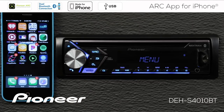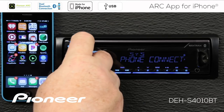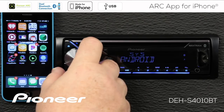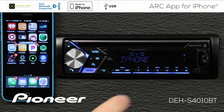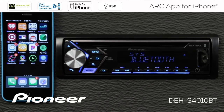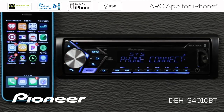We're going to turn the head unit off — press and hold the source button for a couple of seconds. Then we'll enter the system menu. Here's the system menu; roll along until you find Phone Connect. Press enter, and now I can choose iPhone, Android phone, or other device. In this video I'm showing how to use an iPhone, so choose iPhone. Then we have two connection types: Bluetooth or wired. We're going to start with Bluetooth, so I'll confirm that.